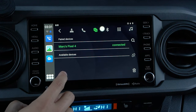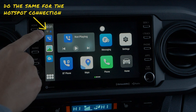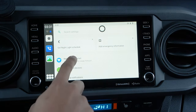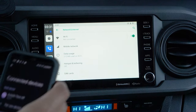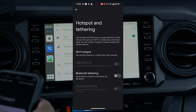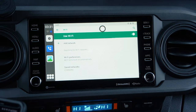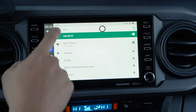You'll notice that your phone's name will also appear in the device list. Do the same for the Wi-Fi hotspot, which you'll need to watch Netflix, YouTube, and access all the other apps. Go to the settings app, click network and internet, and ensure that the Wi-Fi tab is turned on. Then go to your phone's hotspot and tethering, allow use of Wi-Fi hotspot, and connect that Wi-Fi on your entertainment system. You'll need to input your password for the first-time connection. The Wi-Fi symbol will then be lit up and ready to use.